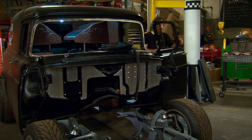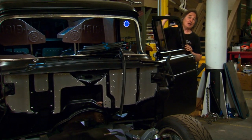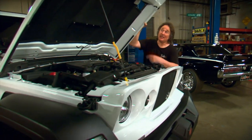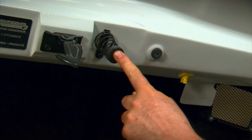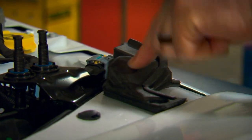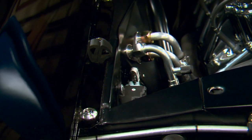I'm talking about the bumpers and the adjusters around the doors, under the hood, in the trunk, around the glove box — that kind of thing. The adjusters help establish the fitment of your doors or hood or trunk lid. The rubber bumpers keep the hood, the doors, or panels from moving or squeaking or vibrating when they're closed. So they definitely serve a purpose.